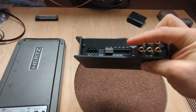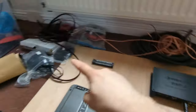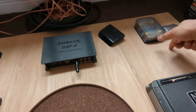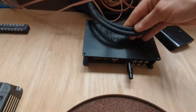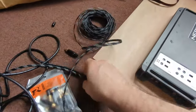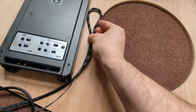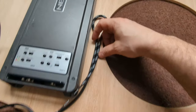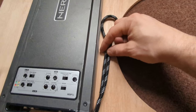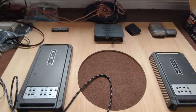There's also going to be a remote wire - power in, out and remote - and probably with the DSP I'll just have four wires all in one braid and they come out here. With the power there'll be a distribution for the remote, running in between the two big power wires - one small wire in between two big wires to run the remote, probably at the bottom so you wouldn't see it at all. If I'm going to use this braid, I need to make sure that when the RCAs are next to each other they all align and follow each other, because if they're not aligned it won't look good. If all five follow each other perfectly it's going to look very, very cool.